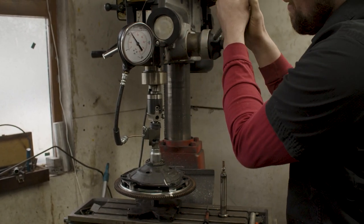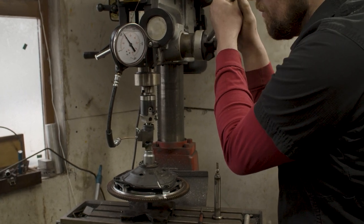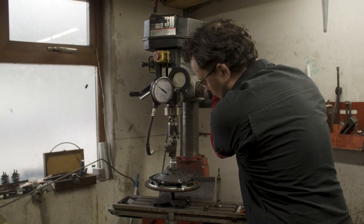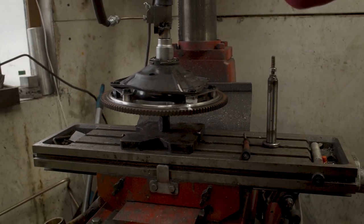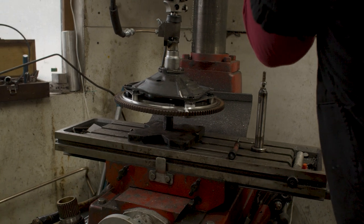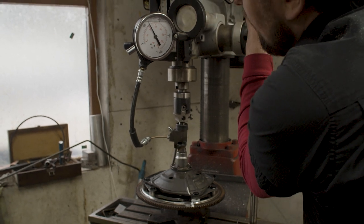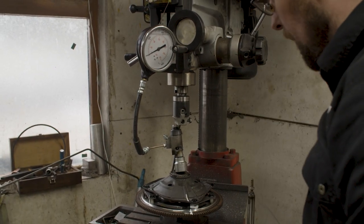Our release pressure is just about 80 bar or 1200 PSI. You can just see it releasing there as I press it down — there's the flywheel release. We watch our pressure gauge and it comes up to its release pressure, just a hair over, and there's our release point. So that's our release point — just 1200 pounds per square inch. When we set this flywheel up properly we should see that pressure reducing. What we'll have is a nicer feeling clutch pedal and we'll be taking load off the crank thrust bearings while also increasing the clamping force on the flywheel.